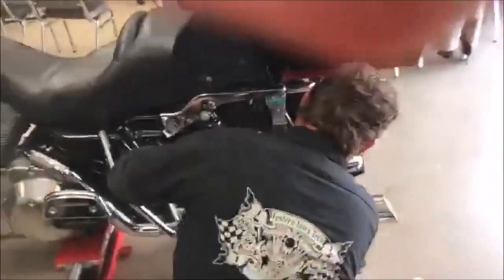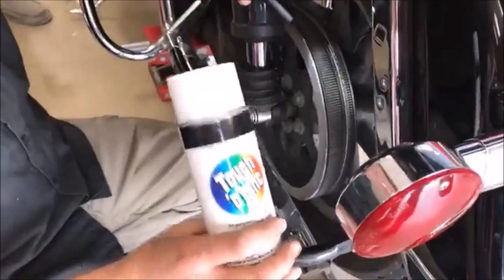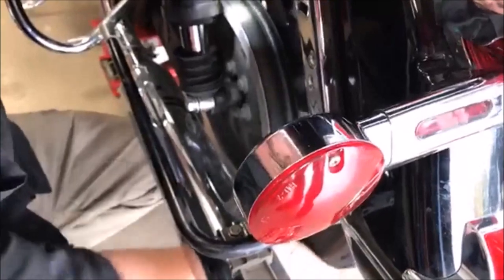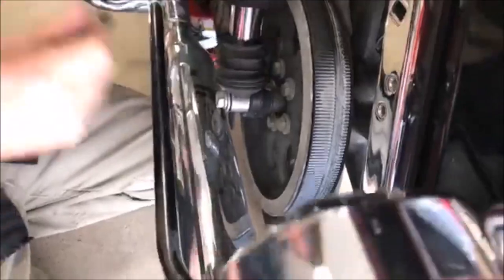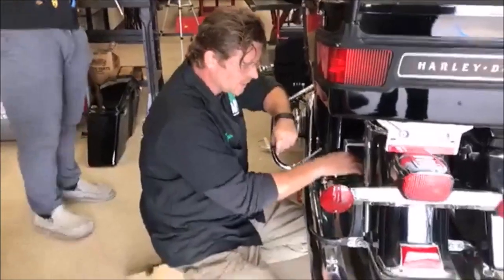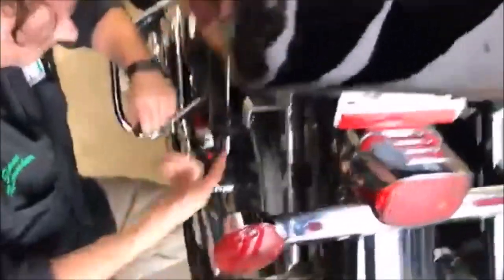Here's a little trick I like to do. When I left home this morning, I decided I wanted to create my own witness mark. I took and actually painted sections of the belt. So by having this witness mark, if something was still rubbing in there, it would smoke off the paint. You can see a couple spots here that I put paint on and we're not getting anything.